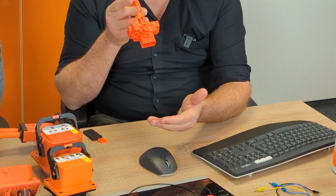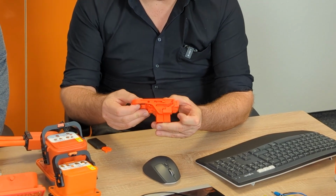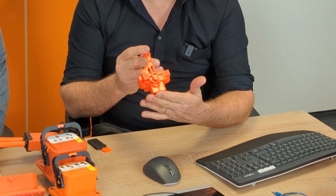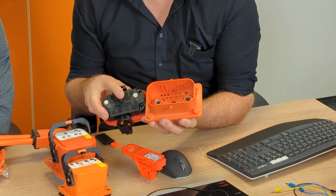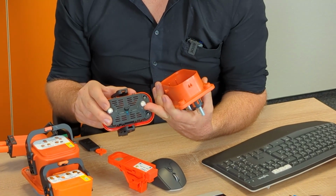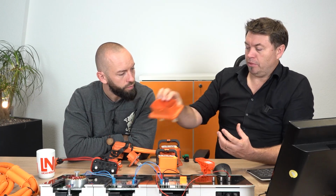All right. So then from here, most people have had experience with this type of service disconnect: you pull that out, and now you're disconnecting the high voltage contacts on the bottom. The point is, you've got a little bit of time at least before you disconnect the high voltage connectors. You often see that as well. For example, here we've got these connectors, which are specially designed so that this connector here disconnects before the long connectors. Okay, I see. That's a very special component of connectors, and it's written into the standards that it has to be the case.